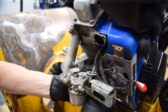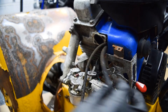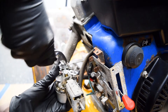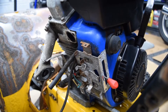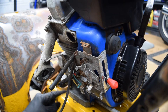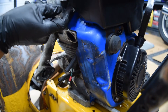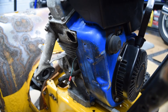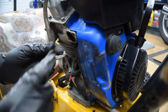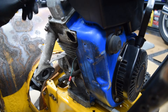There's some sketchily wired-together stuff — it looks like the kill switch broke at one point. It actually has two kill switches: the key and one on the throttle as well. We can delete the primer too since we won't use it. The governor linkage can go away. We're going to use a standard throttle cable and twist grip throttle, so none of that stuff is needed. Also, I wouldn't leave the crankcase breather vent fully exposed — run it to a catch can or put a filter on it to prevent blockage.